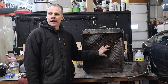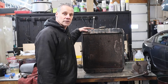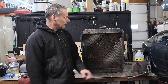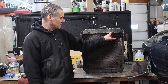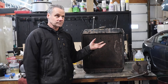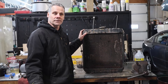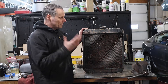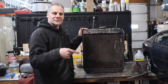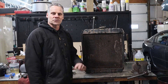We've got a real solid core on it and both tanks are in good shape, but both upper mounts have come disconnected from the upper tank. What we're going to be doing is clean this sucker up, reattach these by soldering them with a torch, and then we'll paint it up and make it look like brand new. The heat came on, so if this is something you're interested in, just stay tuned — I'll show you how it's done.